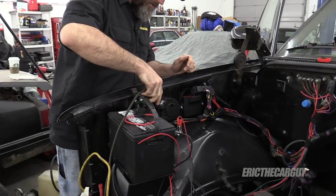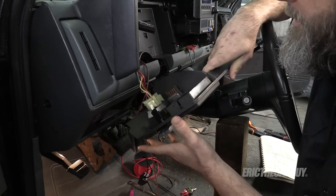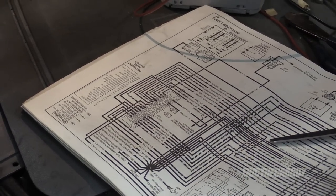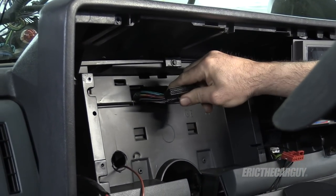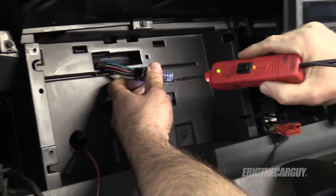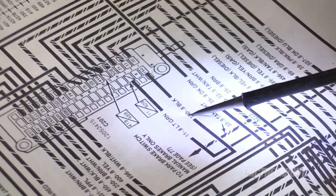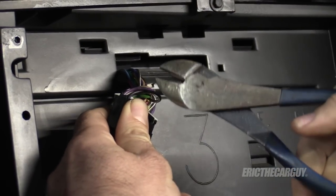I'm going to power up the truck in the way we've been doing this whole time, hook my power probe up, and also hook the headlight switch and the dimmer up. This is how the connector is inside the dash — this little piece off to the side is the plastic clip that went up into this part. So as the connector slid up into here, that's where the plastic clip goes — that's how I'm orienting it. Circuit 150 black should be this one down at the bottom right here. It is a ground. That wire coming off of there is just black — so 150 is just a black wire coming out. Bottom left-hand corner should be a black wire, and lo and behold, all the way down in that corner — black wire. We're going to label this as ground.